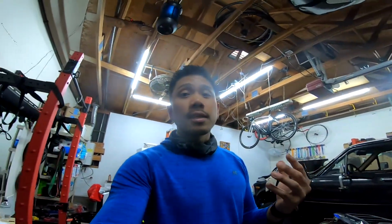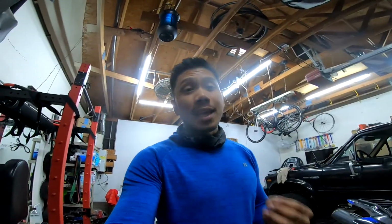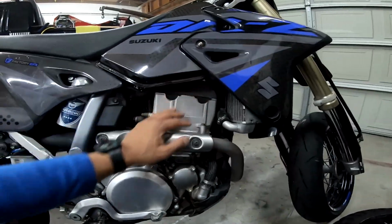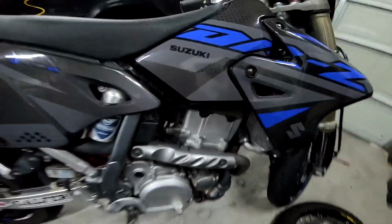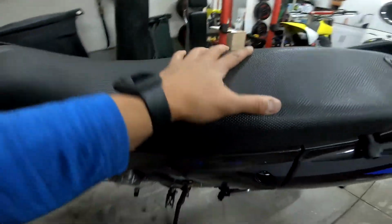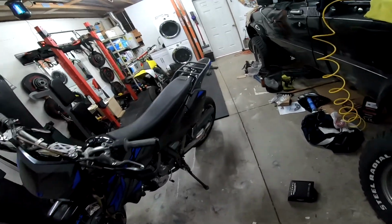Now we took this basket case of a motorcycle on because it had really good potential. What we have here is a big bore kit as well as an FCR carburetor. Let me show you that around. It has the upgraded carburetor. It also has the 3x3 mod. And it had all stainless steel lines front and back. So it had great performance potential.